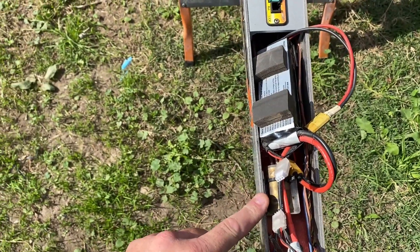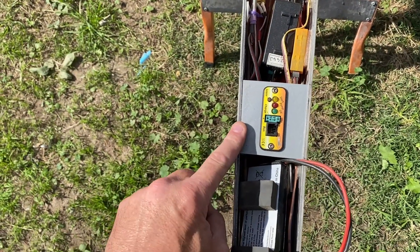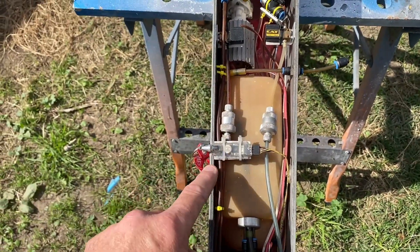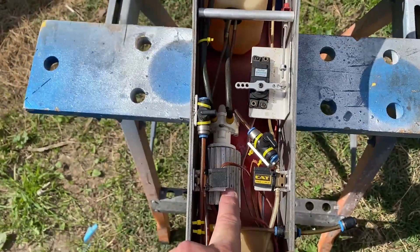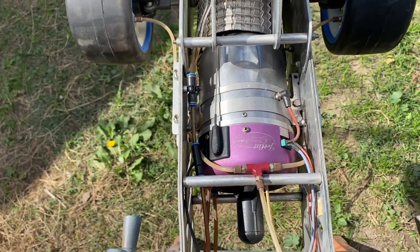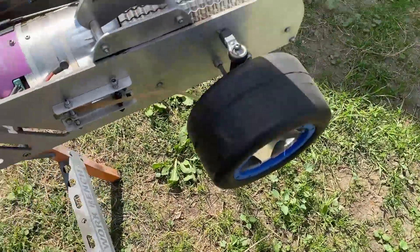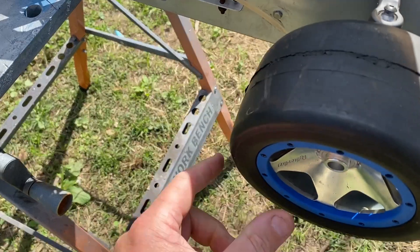Motor to deliver fuel, ECU — the substation or bus — up there ECU, main fuel tank, on/off switch pull and the thing turns on, motor for the afterburner, afterburner tank, and the JetCat P80 SE. This also has hydraulic brakes — it's a master cylinder which delivers twin brakes to the back wheels.